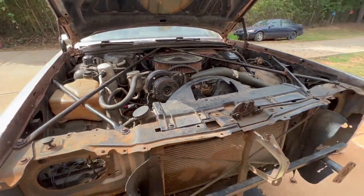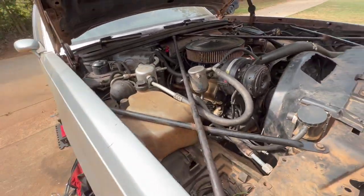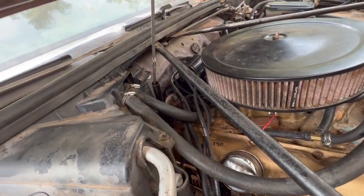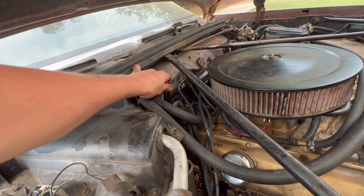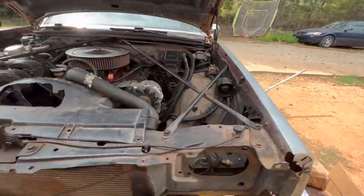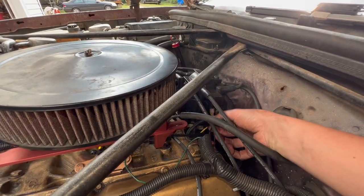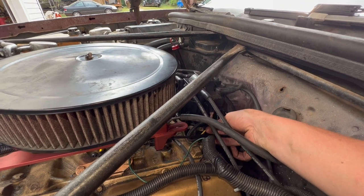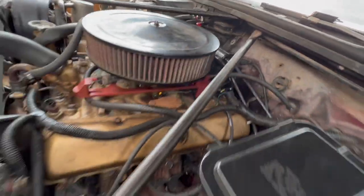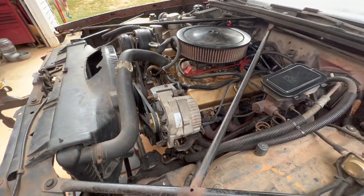All the bolts are in. The next step is we're going to fire up and shut it down immediately — that torque converter is going to start filling up. I should have plenty of fluid. I don't think I got anything disconnected. Let me check our distributor. Our ignition wires are hooked up. Our tach wire is a no-go. Got it — lucky me. Should start a lot better now. We got our grounds hooked up — happy about that — got the alternator. Let's see what happens.